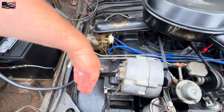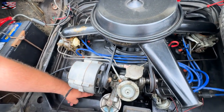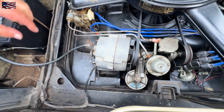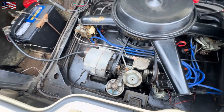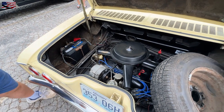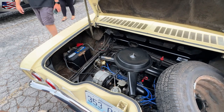The air comes through the shroud and is forced down through the cooler. There are dampers here also, so the cooling air is actually thermostatically controlled. There are bellows back underneath the engine that, when it heats up, open those dampers and allow more air through. General Motors did a lot of engineering on this.